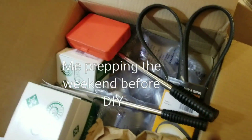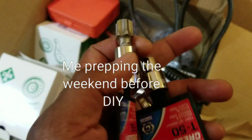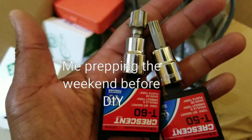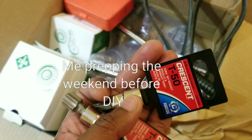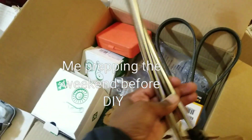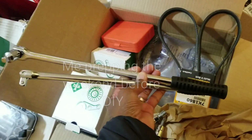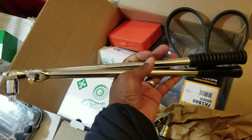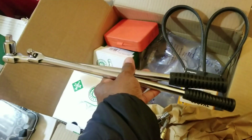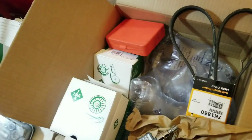So what's up, guys? This is everything you need to do the belts. The belts came in from ECS Tuning. I needed to order these from Amazon before I could do the work. You need a T60 to detension the tensioner and release the belts, and a T50 to remove the pulleys. And I'm gonna use these two breaker bars. If you've followed my channel for a couple of years, you know I've had these for about 10 years now. These are what I used when I did the belts 10 years ago on my 2001 E46 330, and so I have all the pulleys ordered from ECS Tuning.